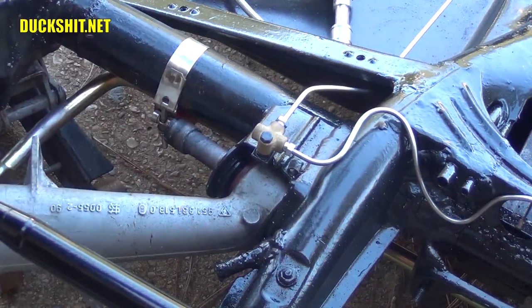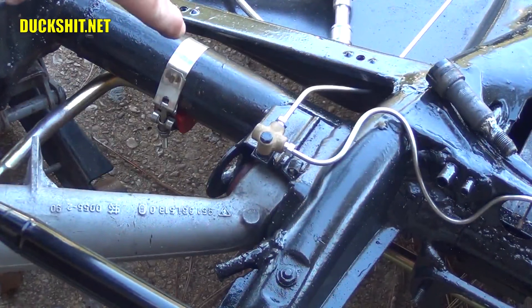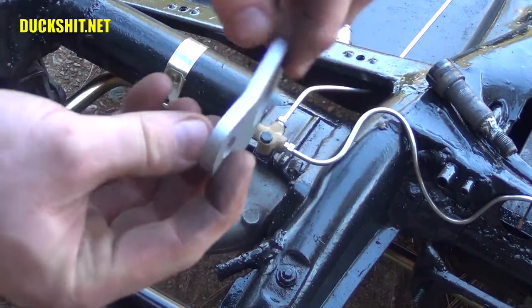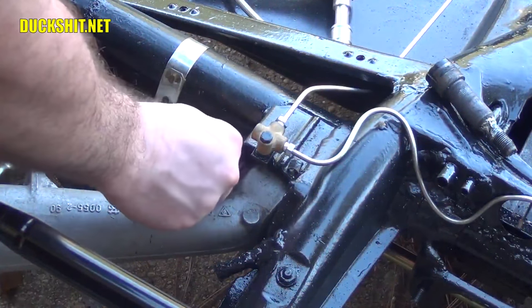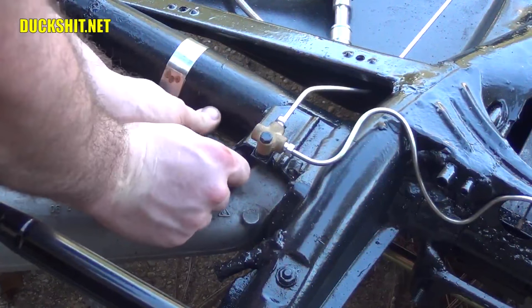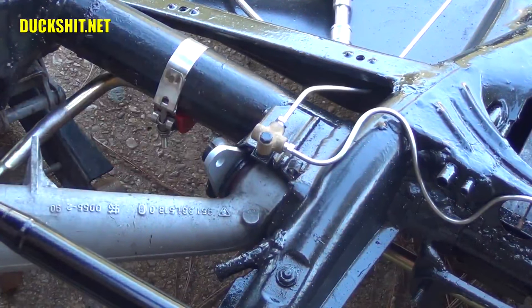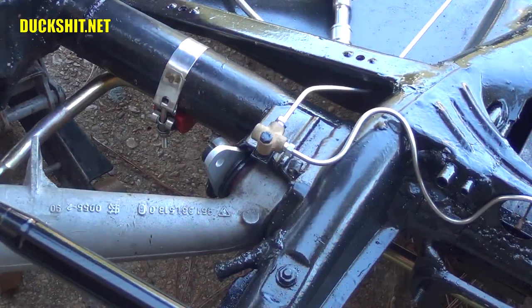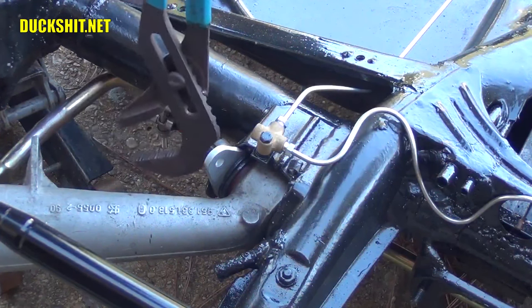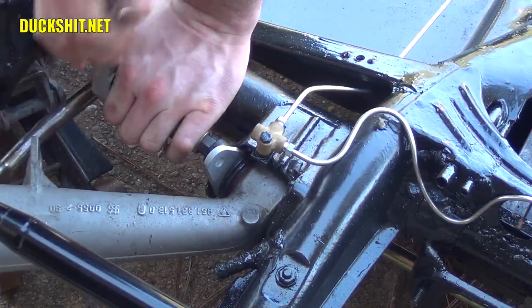You want to pull out the IRS bolt and there's two washers that are behind this here. Both washers actually get bundled together, which is kind of weird — they kind of fell in, but when I shove the bolt back through I can fish them through. You want to put this bracket with the tab facing to the outside of the car this way, then put your bolt back in and get it threaded back into where she goes. That's kind of interesting that there was actually room in there for it — almost like it was intended to be that way from the factory. You might have to gently tap it — probably a mallet would be best.